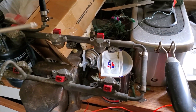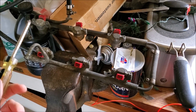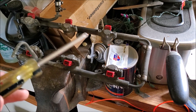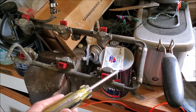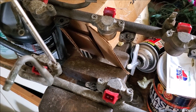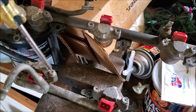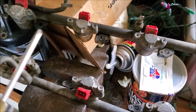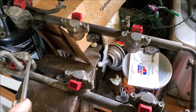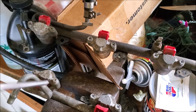Once you actually remove the fuel rail from the plenum, it's pretty simple — just take your time with it. If these haven't been done in a long time, they'll be super tough to get off. The early style ones I've always dealt with have these round phillips head screws, which are a pain. Someone must have done these injectors before because these have different bolts — the ones I've dealt with had round ones, but these you can just throw a socket on, so it's a little easier.